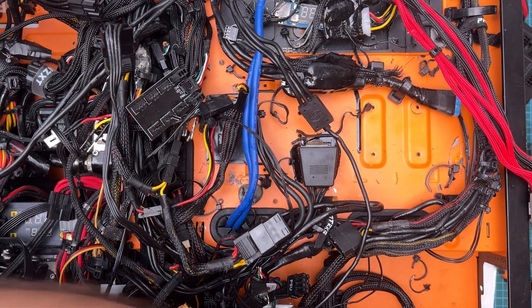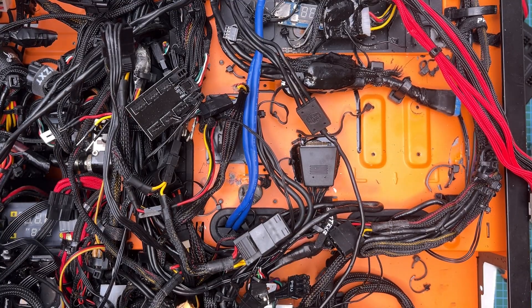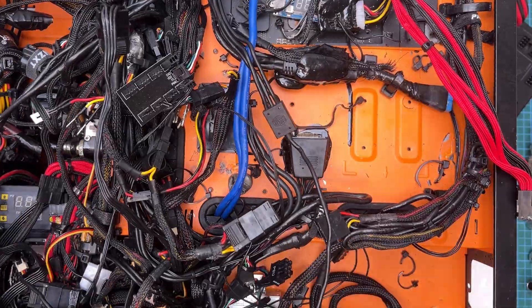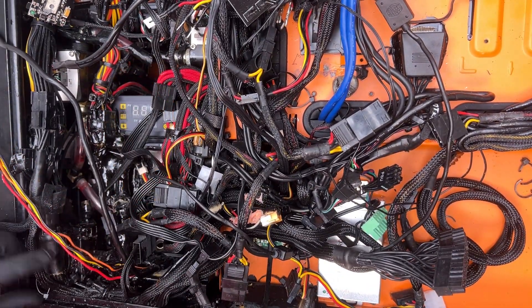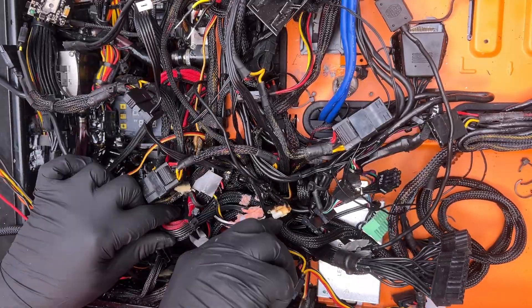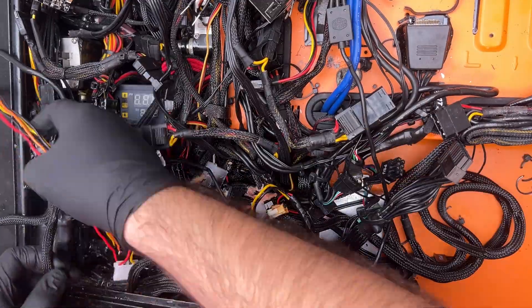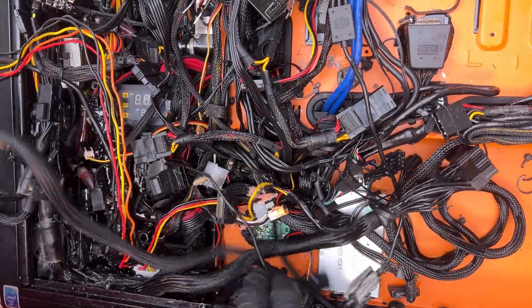Now you might be asking: why is this machine running two GPUs with three GPU cores between them? No idea — but even back when this PC was new, that would have been a very poor choice of hardware, not to mention very expensive. It has a 750W good-quality PSU, about four pumps in the same loop of wildly different flow rates. I say about four pumps because there might have been others I completely missed, but they would definitely end up gating each other.